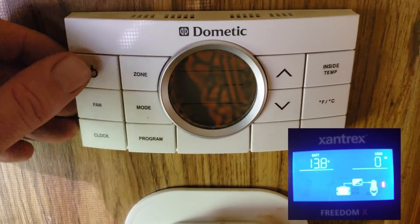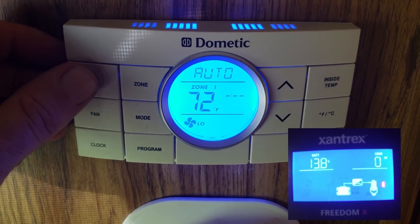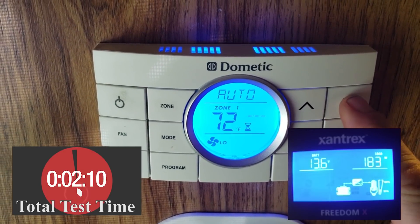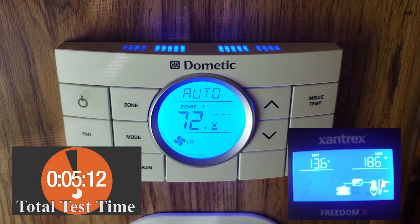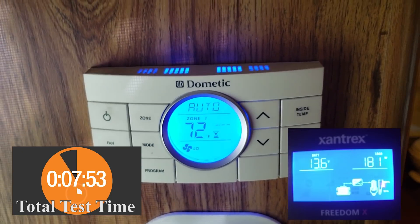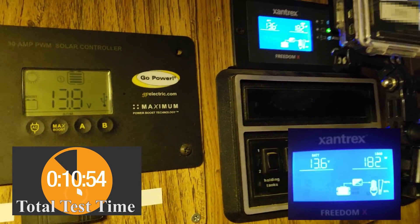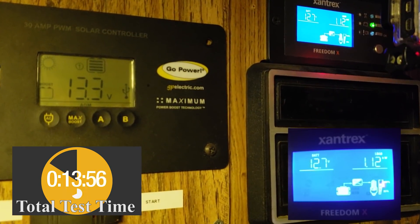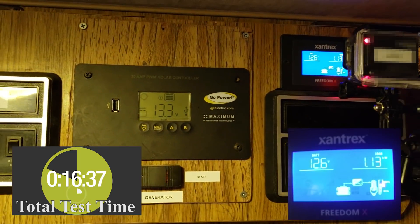I'm a little nervous but I think we're going to be okay. Let's turn on the power here. The fan has started — it is running. You can see the inside temperature here is at 86 degrees and it's set to 72, with the fan on low. It's going to take a minute for that compressor to kick in. Right now we're drawing 182 watts. There we go — it just clicked on and we're pulling about 1100 watts. The compressor is just getting going and it'll be higher once the AC really gets wound up.